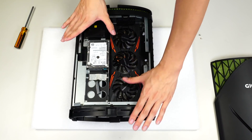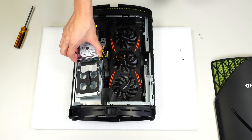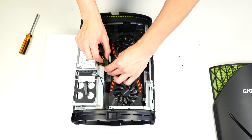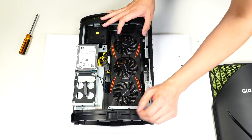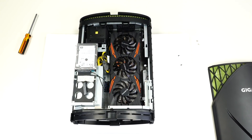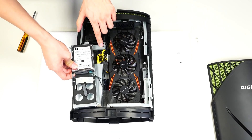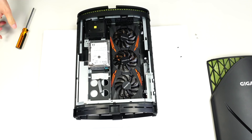Once you have those screws removed, push upward and the hard drive bay will pop right out. You can see all the cables here that power the graphics card. Since the power cables are hidden inside, we're going to disconnect the power connector. Make sure you've unscrewed that front screw first, then push upward and lift out the graphics card. Put in the new graphics card you want to install into your Gigabyte desktop PC. Once installed, do the reverse — reinstall the hard drive bay, align the notches so everything fits properly, push it back, and screw it in to make sure it's secure.